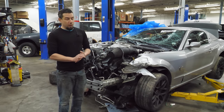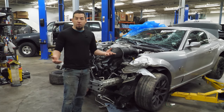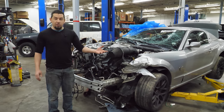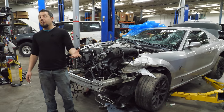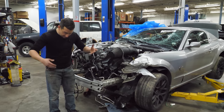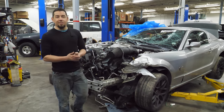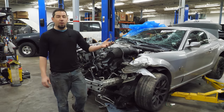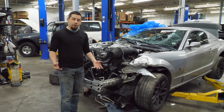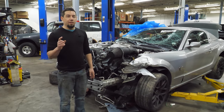Just considering how locked up it was, it's hard to say whether this was a good engine or a bad engine when it was flooded. Typically a complete running and driving vehicle has a sealed cooling system so flood water has no way of getting in. We saw water everywhere in this engine, which leads me to think that maybe this thing was half taken apart in somebody's backyard when it was flooded - maybe had no radiator in it - or maybe the engine was stored somewhere that was flooded. We'll never know.